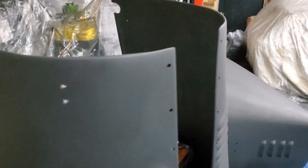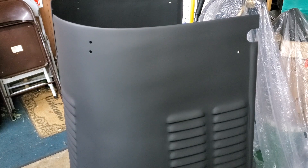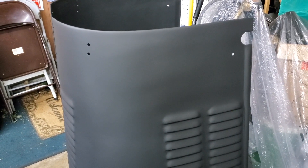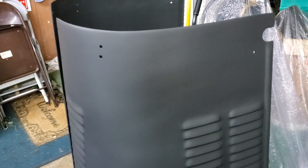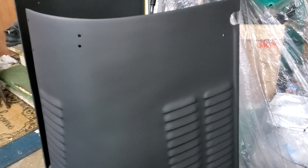There's also the passenger's hood panel, which previously had the whole leading edge cut off. What I did was epoxied the two cuts together in a butt joint so the hood could be usable during mock-up. Then, when it came time to finish all the panels, I ground a valley down the length of the joint, epoxied it over, and once it cured, did the same thing to the joint on the inside. After some sanding, the feathered joints disappeared and the panel looks like it was always one piece.